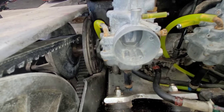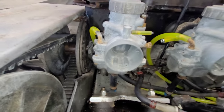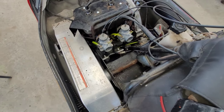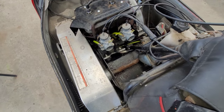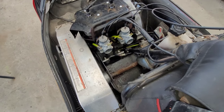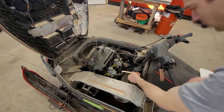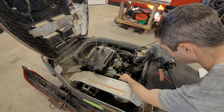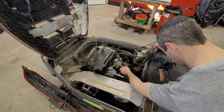So if I show you what I'm talking about — when I activate the throttle, these slides are going up and down. How do we make sure that both carburetors do that simultaneously? We're going to use extremely proper tools — just kidding, they're just popsicle sticks. We're simply going to take these popsicle sticks and set them just inside the slide here, with the weight of the popsicle stick hanging down just like that.